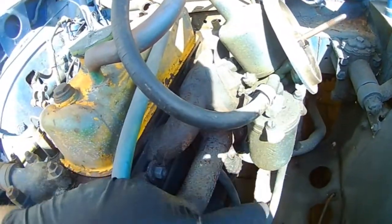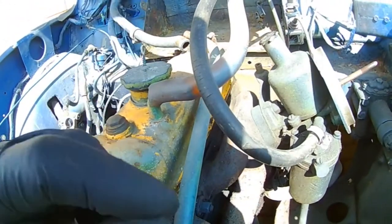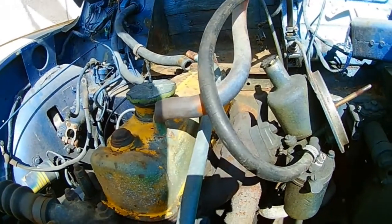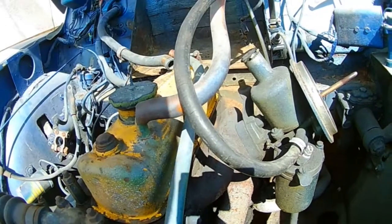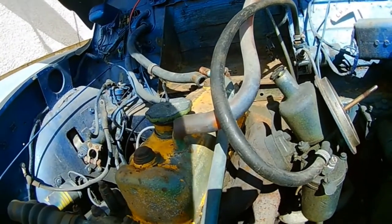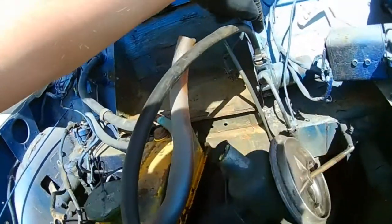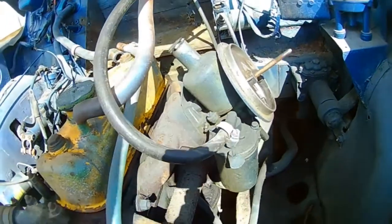Then we can focus on the fuel line. You can see it's pretty cracked here. When I tried to start this the fuel was pretty low, so I don't know how much fuel is in here and I haven't drained the tank — so I'm going to put a clamp on. I'm not bothered about breaking this or damaging it because it'll be getting replaced. Once I've got this undone and pulled off I'll get a basin, and if there is any fuel it'll just drain out. I wouldn't imagine there's much because the fuel pump's not ticking. Be wary of the dangers of working with fuel — flammability, etc.